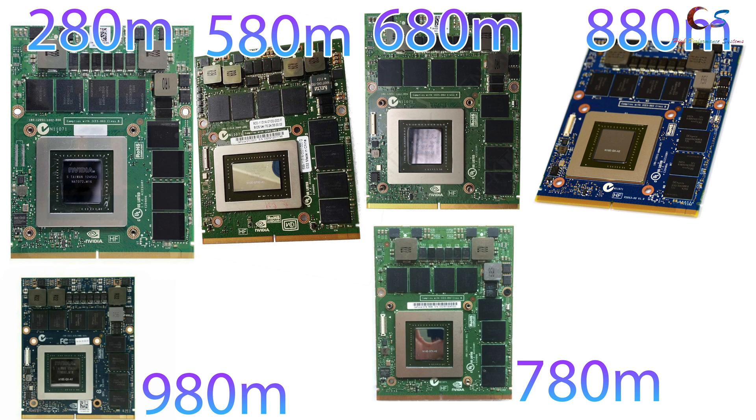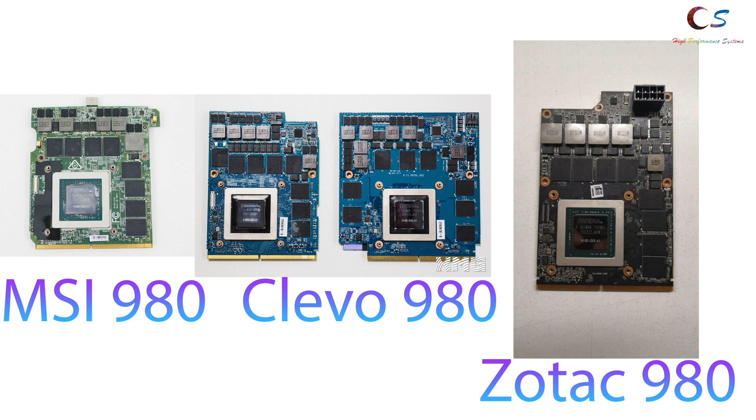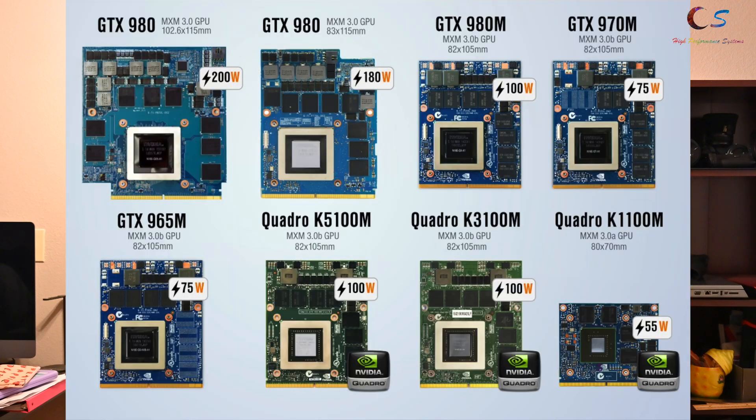The 200, 400, 500, 600, 700, 800 series — there was an 800 series for mobile — and the 900 series all had a standard MXM 3.0B format for all the high-end cards. With the 900 series, NVIDIA announced the 980 desktop, and the 980 no longer followed the standard design. This is because it used more power than these modules were originally designed for. The Type-B is normally supposed to have a 100-watt TDP, and Type-A normally has a 55-watt TDP. The newer designs had 150 watts, 180 watts, 200 watts. The excuse back then was that NVIDIA no longer provides the reference design, so manufacturers have to design them themselves and they require external power, just like desktop GPUs.